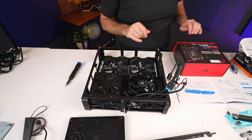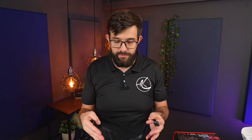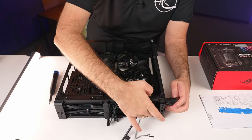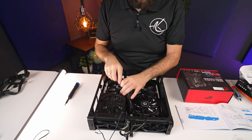In a small case like this it's really important to think two or three steps ahead. The next task is to install the graphics card, but first we need to put the bracket in — once that's in, connecting all the cables becomes a lot more challenging. So take the CPU 8-pin cable and loop it behind the motherboard straight into the header at the top. That's probably the safest choice at this point, because depending on your motherboard you may need an extension cable just to plug in the 8-pin connector. I really appreciate that this case can be taken apart for the most part.